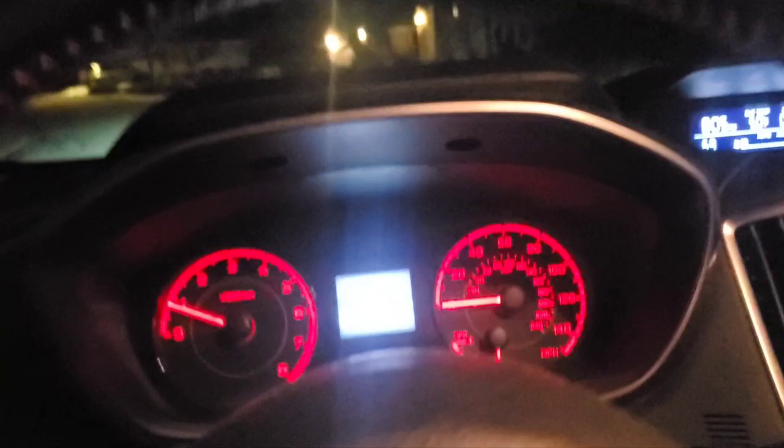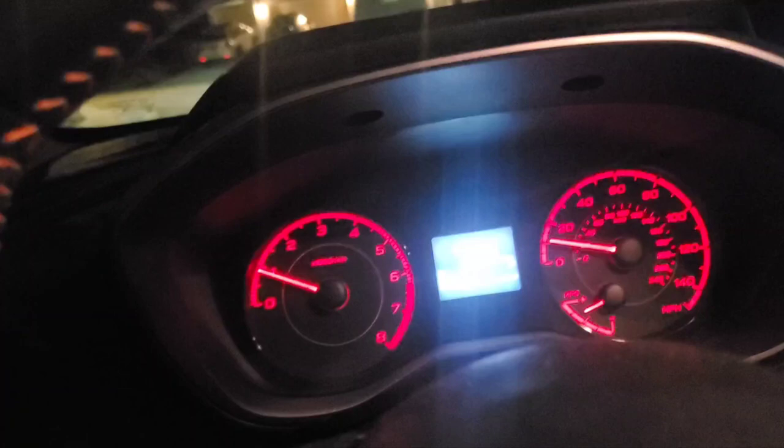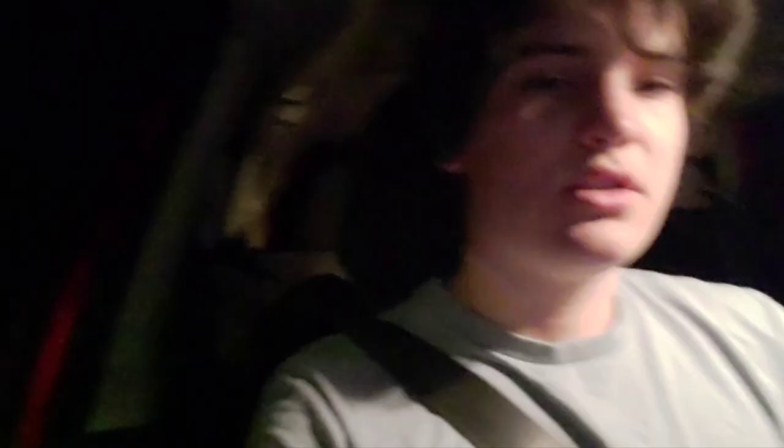So we're going — first gear, driving. You can hear the engine; it's at 3,000 RPM. But if I pop in and go to second gear, it's the same speed but the RPM is much lower. You only have around 8,000 RPMs total, so you can't stay in first all the way up there. As you get into higher RPM ranges the engine gets weaker and weaker. That's why you change up gears — to keep the RPM low. Going above 3,000 is fine, it's just more wear and tear on the engine compared to staying in the 1,500 to 3,000 range, and it decreases the lifetime of your engine.